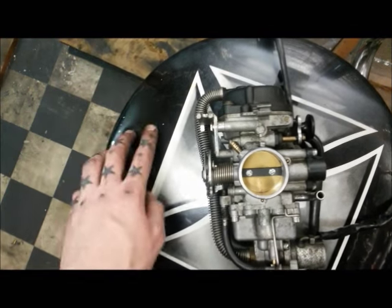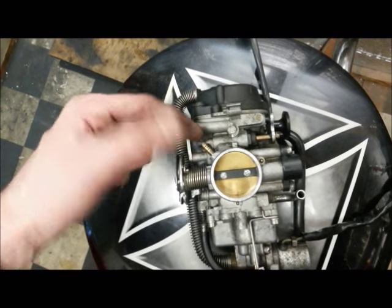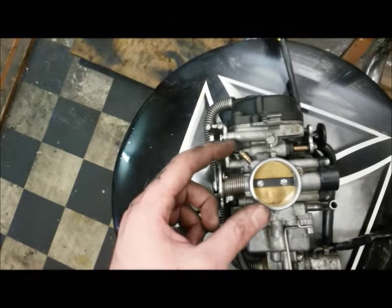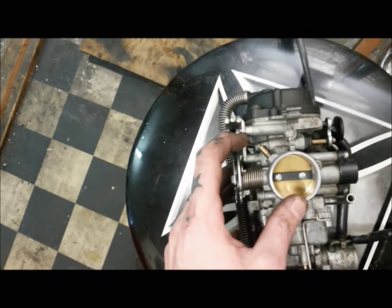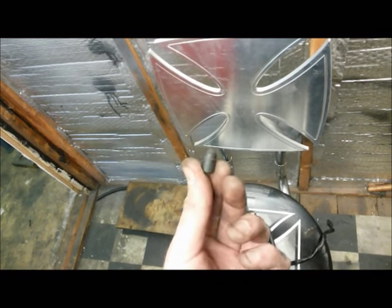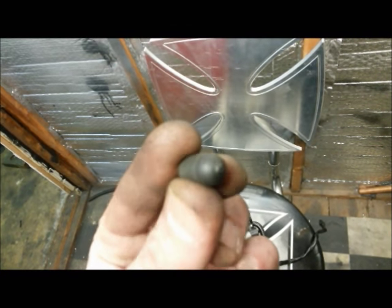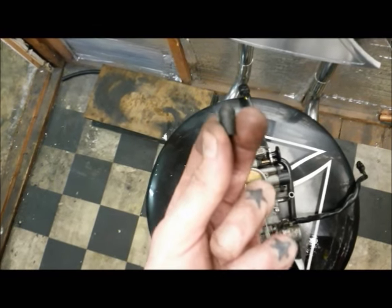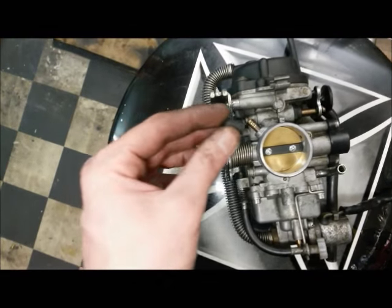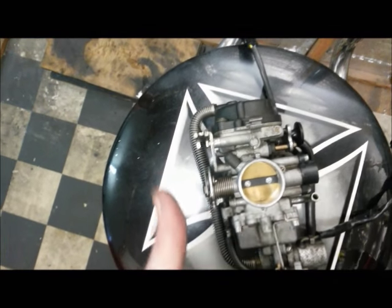When I took the PAIR gubbins off, one of the tubes snaked all the way up, went in here, just by the butterfly here. And so this obviously needs to be bunged up. Some people have cut a bit of hose and put sealant in it. I had a rummage around my bits box, and these little rubber nipples came with the British Customs or whichever air injection removal kit I got. It's like a little nipple, isn't it? And obviously I don't use those on the EFI ones, so they just went in the parts box for just such an occasion, because that fits perfectly. So, that's sorted.